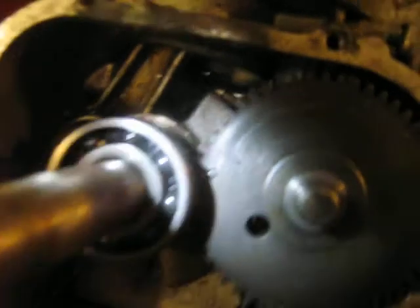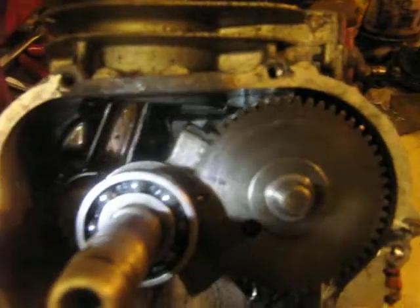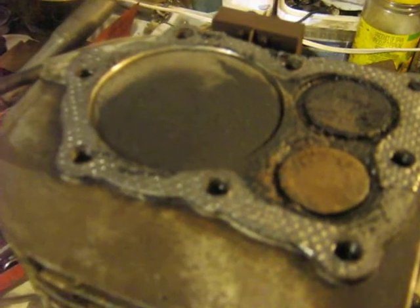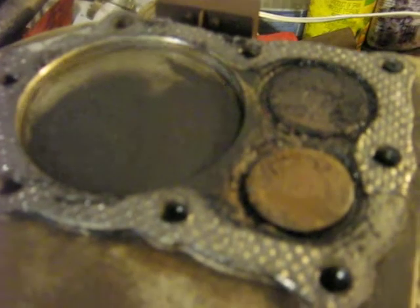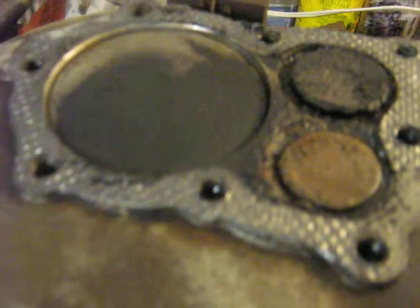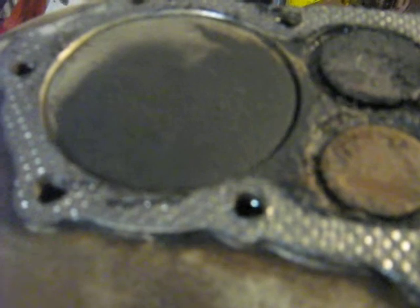You put it in just this way and test the valves. When you run the piston up to the top, both valves should be open fractionally right at that point. You can see the intake is trying to open and the exhaust is closing. So the piston's just coming to the top — that would be another check.